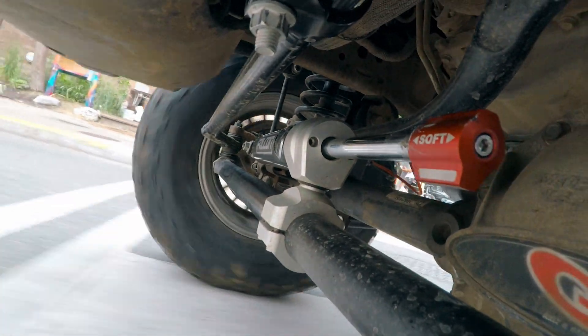That's it — we did it. We installed the three products: the HD drag link, chromoly tie rod from TeraFlex, and the Falcon Nexus EF 2.2 steering stabilizer. Super simple install and the Jeep is feeling great. You're going to want to go in there and make sure all the ball joints are torqued down to their specs — 90 inch-pounds — so make sure you have a torque wrench that goes down to that low inch-pound setting. And don't forget to grease all those Zerk fittings with a high-performance grease. Right off the bat, the Jeep already feels way stiffer and firmer. Replacing all those tired ball joints is really stiffening things up and it feels really good.